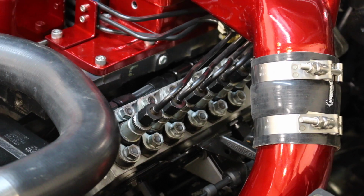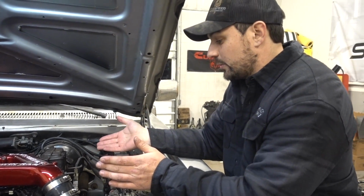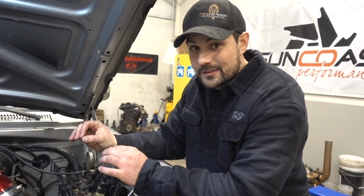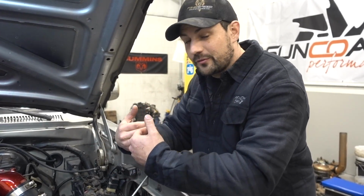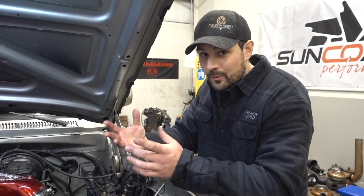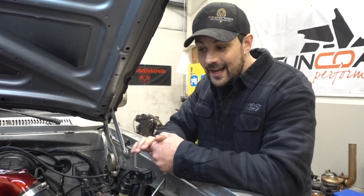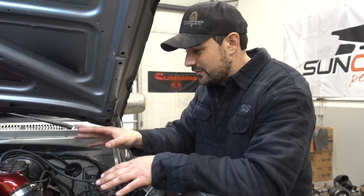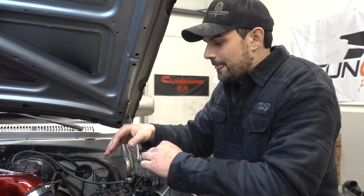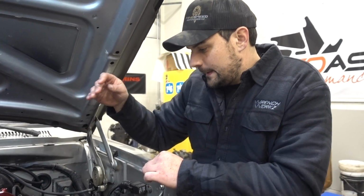Fuel, other than that, we pump it into our Feral Diesel. I believe this is a stage 4. It's the biggest 12 millimeter pump that they use, and it has been seriously awesome. Not coming from a guy who knew pretty much nothing about P-pump stuff, with a little bit of help from our man Mikey G, of course, as always, setting up the timing, running about 25 degrees, which may be a little too much for these, but that's okay. Stock lines, we can use stock lines with a 12 millimeter pump, so we did that.